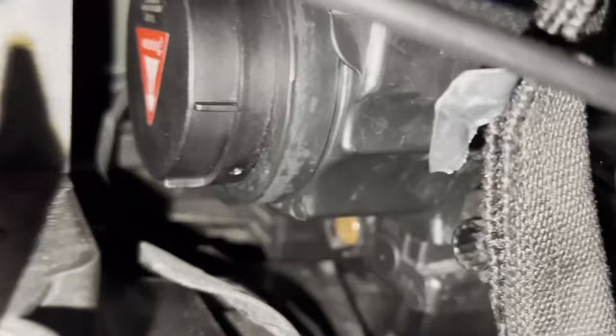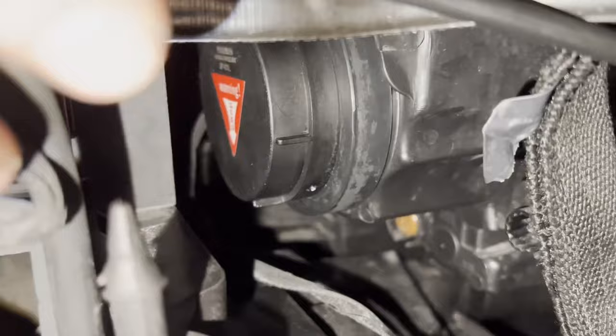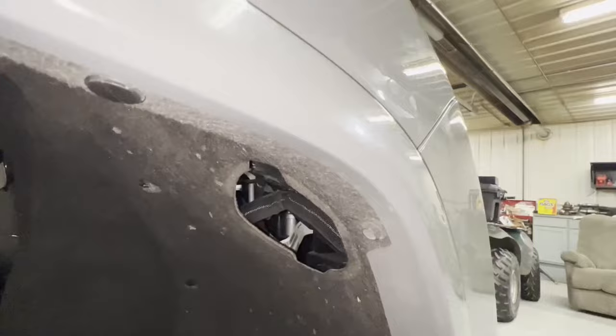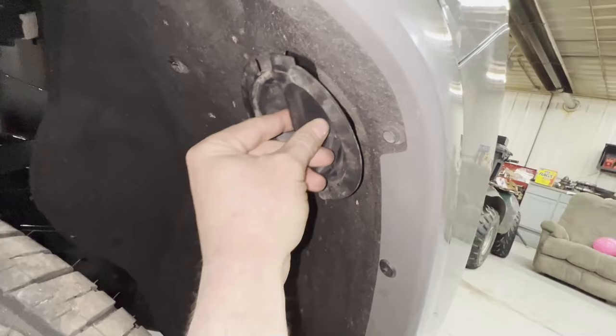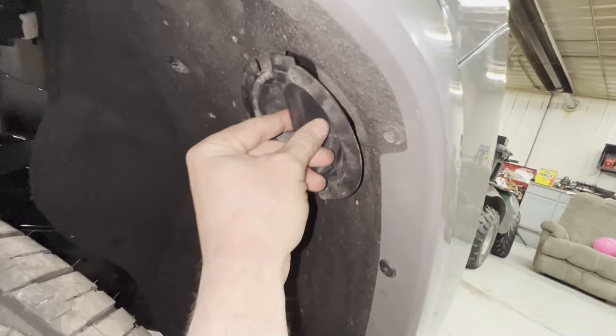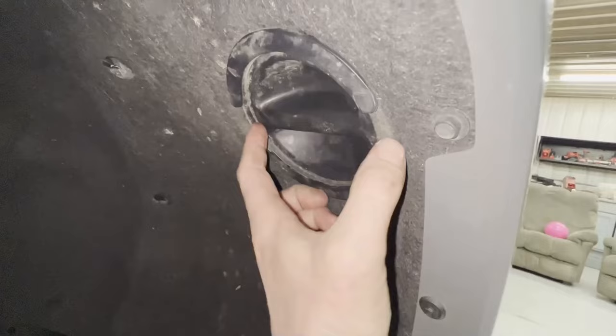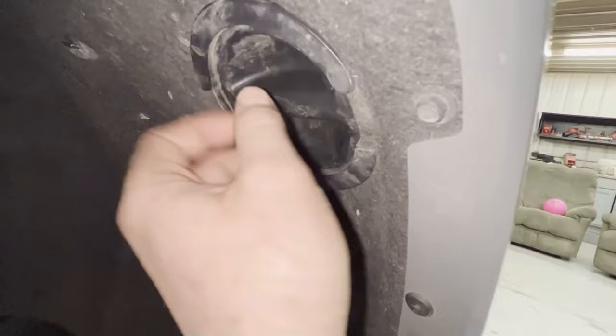Repeat all the same steps on the driver's side. Once done in the wheel well, note the cutouts on the top and bottom — line up the dust cap with those and push it on, then rotate it about 90 degrees so the tabs are offset from the cutouts. Make sure to push in firmly while rotating; if you're not pushing in, you might only get one tab catching. Make sure both tabs are fully engaged.